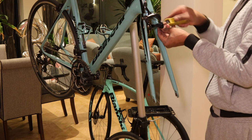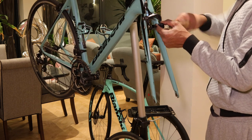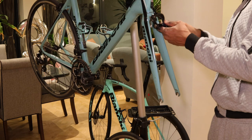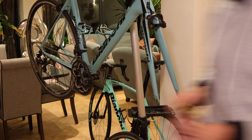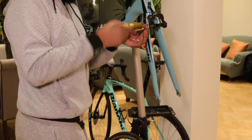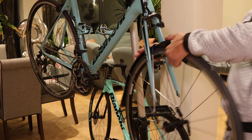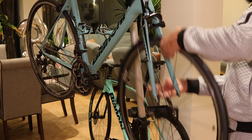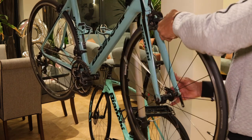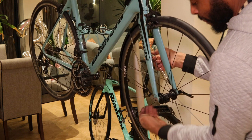Here I'm just removing the little screw that's holding the brake pad in. Once you've taken that screw out, the actual brake pad itself slides out — it only comes out one way; it slides towards the back of the bike. Because when you're braking, if it was going forwards where your wheels turn, it would push the brake pad out. So it's got a little catch on the front which stops it from pushing out that way. You've got to look at your brake pad — where it's round and smoothed over, that's not the side. It should be flat and open at the back, and then you can slide it out. You can use a screwdriver or your hands depending on how tight it is.